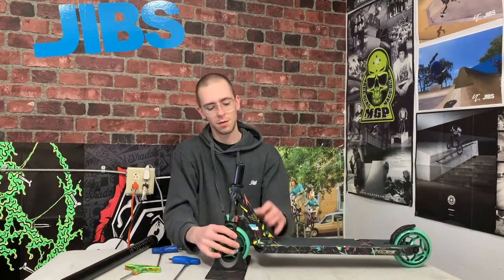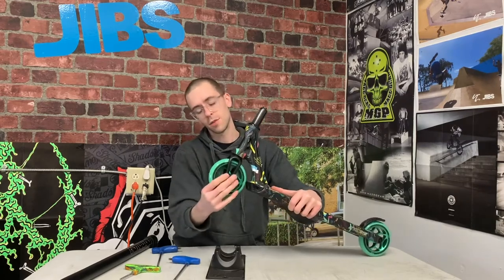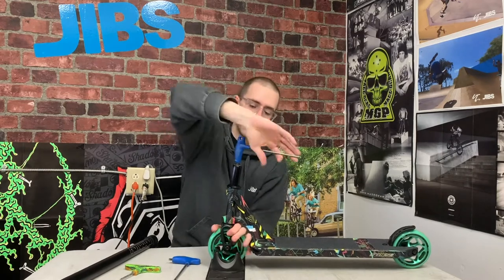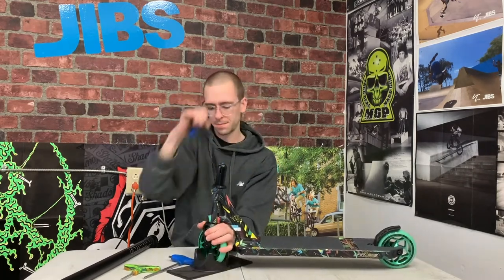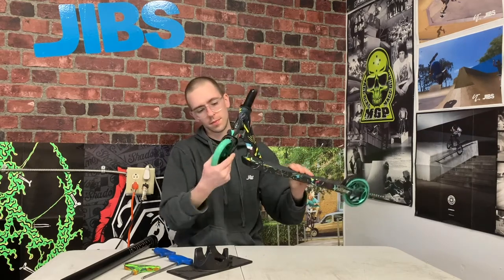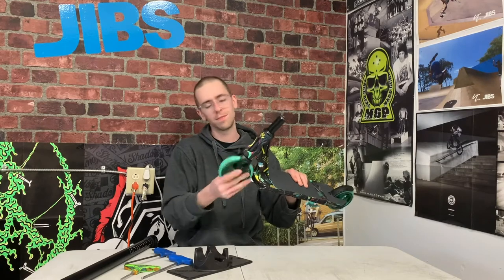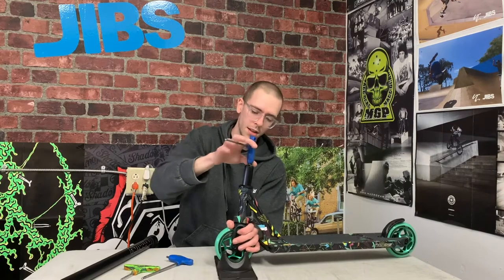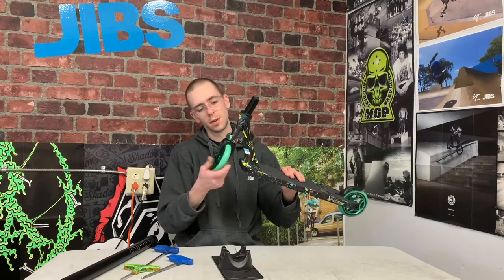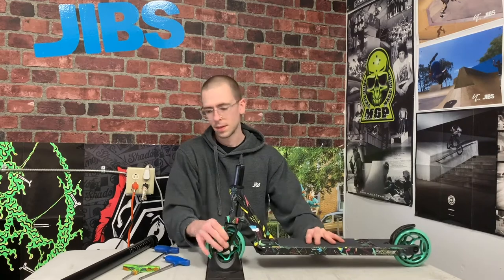If the compression is too loose, the fork is going to move and rattle — that's what we're trying to get rid of. If it's too tight, your steering is going to be too stiff. You want the steering to move fairly freely — you'll feel a little bit of resistance, but if you've got to push hard to turn the wheel, it's too tight. So tighten the bolt until it's just a little bit snug, and now the steering moves smoothly but isn't rattling. Once you've done that, that's all there is to it — just put your handlebars back on.